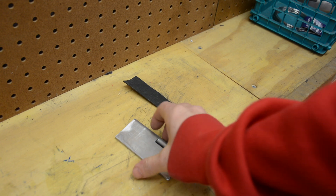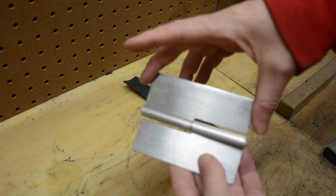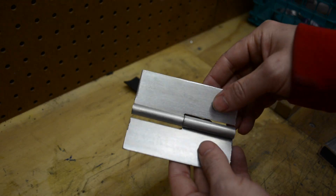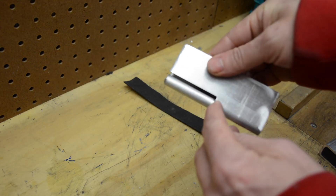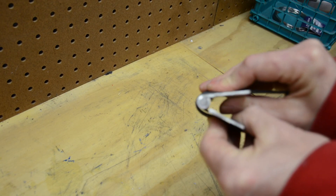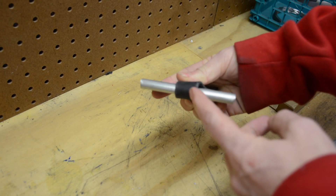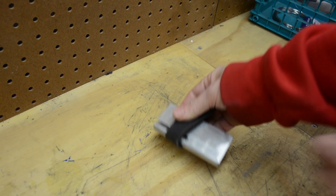The hinge I used is an aluminium continuous hinge, or piano hinge. This is just a cut sample, but it goes the full width of the truck. On top of having the aluminium hinge, I didn't want any water coming through at the connection, so I wrapped some heavy-duty rubber around it. This is what faces the front of the truck, and no water can get behind the hinge.